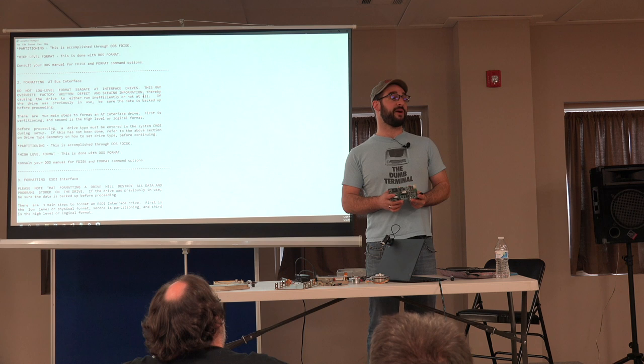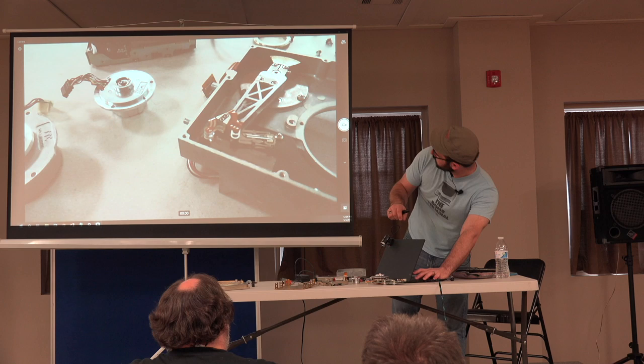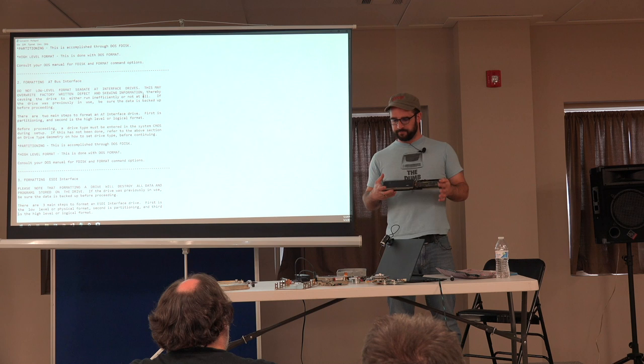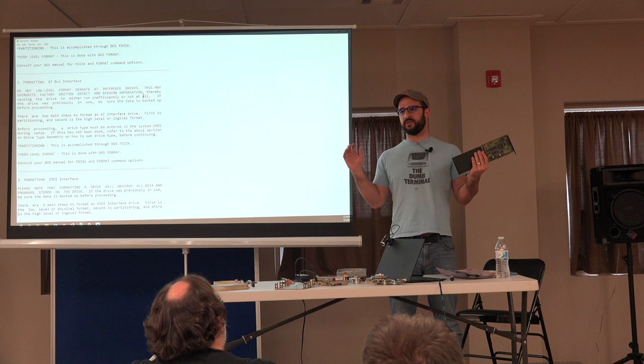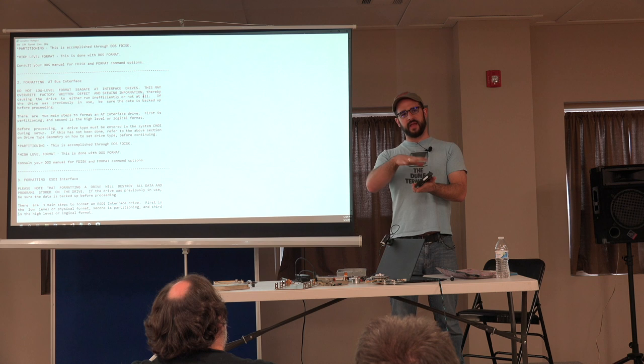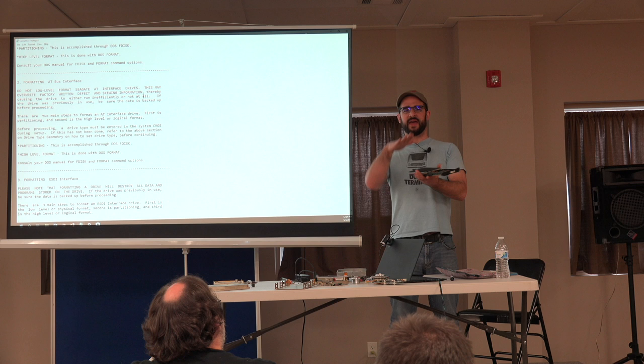Yeah? Did you ever encounter or maybe have any suggestions about things to do with what they used to call stiction? Oh, yes. So, thank you. I actually wanted to mention that. So, when the disk is off, stiction is taking the words friction and stickiness and putting them together. When you shut the drive off, the drive spins down and the head lands on the disk. I think there is a very, very light lubricating oil on the surface of the disk so that touchdown is very gentle.